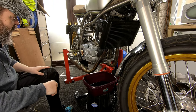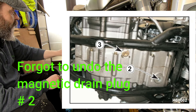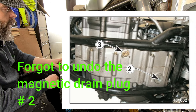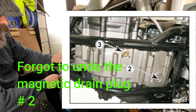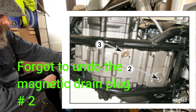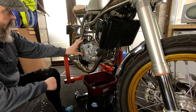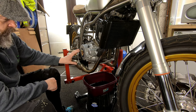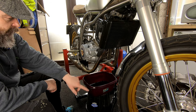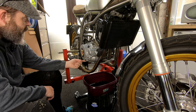So that was a bit weird — I thought this was a dry sump but it isn't. I probably haven't left it long enough for the oil to go back into the sump. So, drain the oil out of it. What I've done is taken off the cartridge on the other side. It's got a cartridge mesh filter which I'll show you in a minute. So what we're going to do, we'll change the oil filter on this side, then go to the other side and do the mesh filter. There is also a mesh filter inside the clutch underneath here.